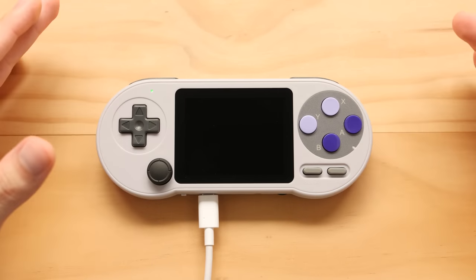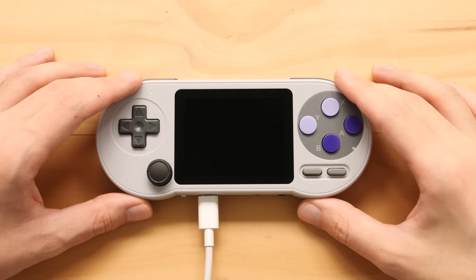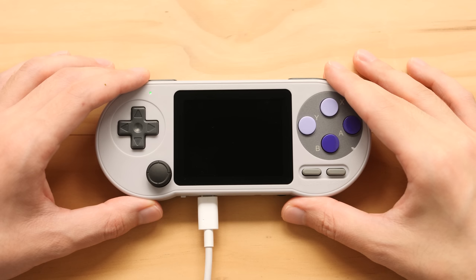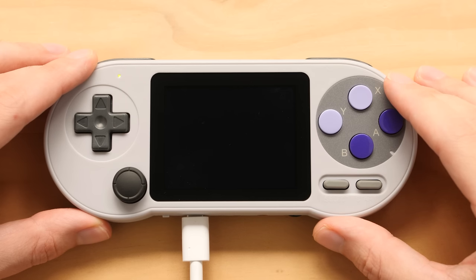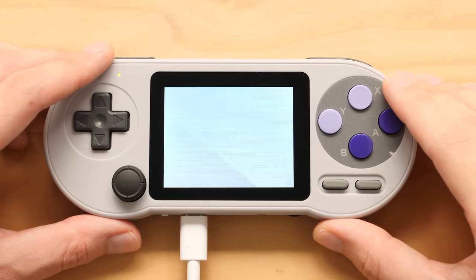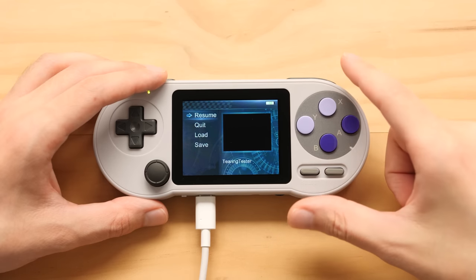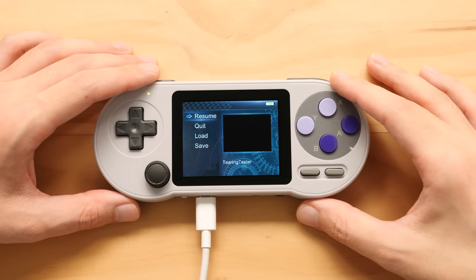This is not the only cheap handheld I've reviewed on this channel. One thing that almost every cheap device seems to have is screen tearing, even in low-end systems that can run well like GB or NES. When I launch a game, I'm seeing some of the telltale signs. We can confirm this with a screen tearing test — if this did not have screen tearing, you would not be able to see these jagged lines. Essentially, the system is trying to display a frame before it has a full one generated. On other devices we can use VSync to fix this, but on small devices like these it's more complicated. The emulator and the screen need to be able to communicate with each other, and on some devices that doesn't happen. Sometimes we can fix this through code, but sometimes it needs code and special hardware, like a screen that can generate a tearing effect signal.